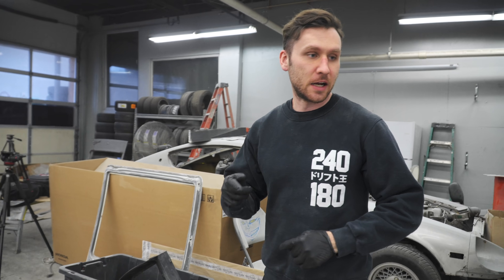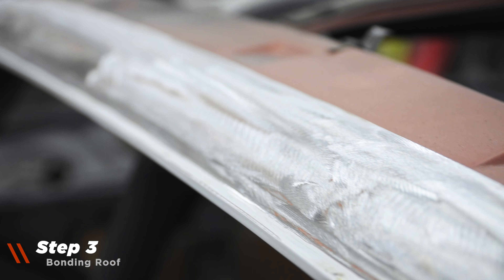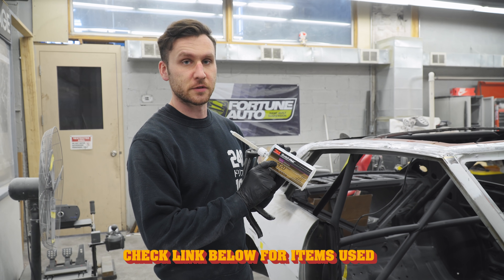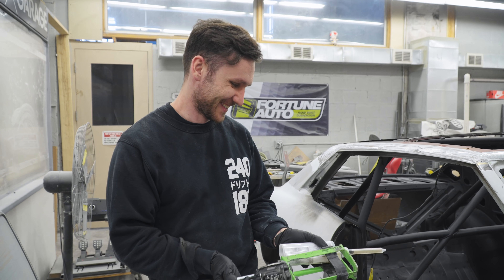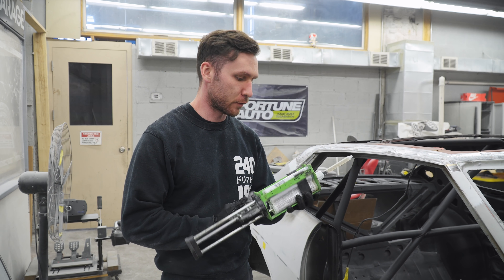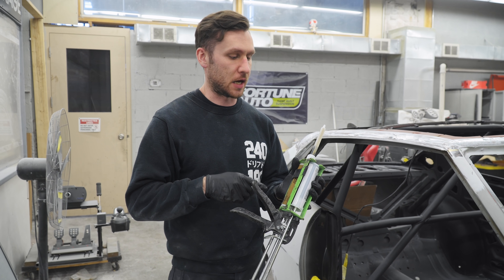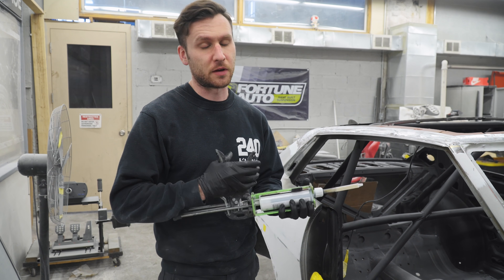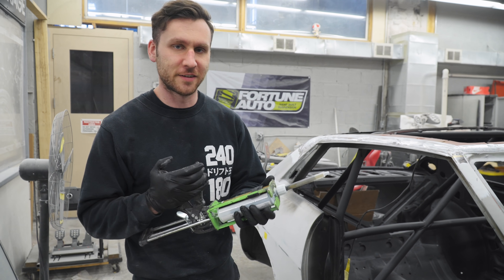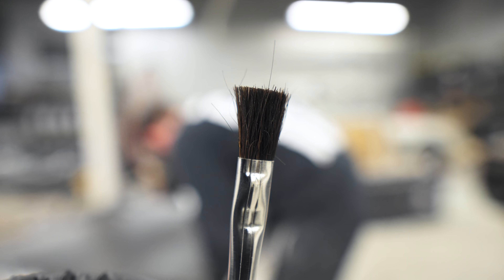Everything is ground down and bare metal. We're going to be using 3M Scotch-Weld DP420 - it's for you, Dave. I've never used this stuff before; I usually use the Norton stuff that's what I used on my roof. But looking into it, this stuff seems to be a lot stronger than the Norton, at least according to the forums. So we're going to test it because I want Connie to be perfect. I'm just going to squeegee a bunch of this out over the whole surface and come back with an acid brush to make sure I get all the bare metal.